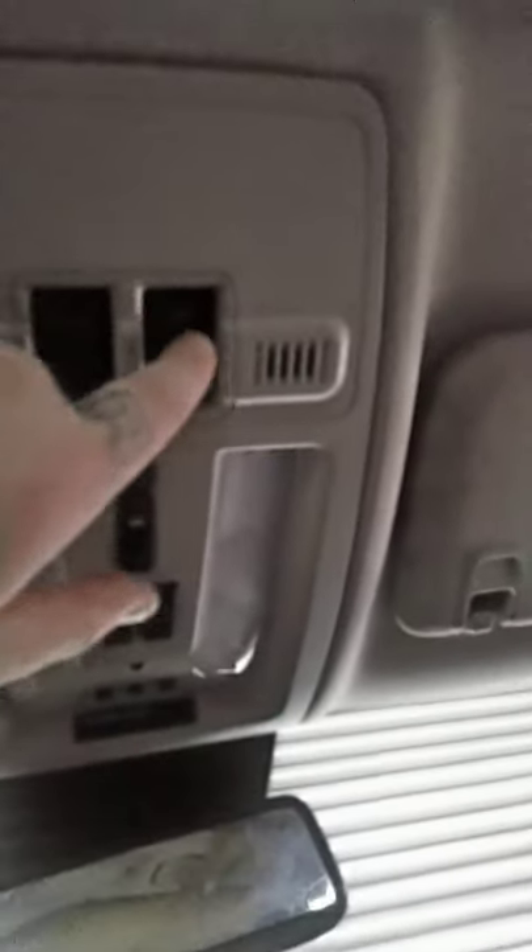First thing you're going to need to do when you get that sunshade — you're going to have your sunroof like that. Your shade will probably be closed so it isn't draping down in your vision. Go ahead, come to your panel, to your buttons, and reel this thing back about halfway. Take your knife and cut all that loose material off the sliding bar that drags it back and forth — just cut that excess material off, hit your button, and run that bar all the way back. Then let's get up out the driver's seat and go to the back.